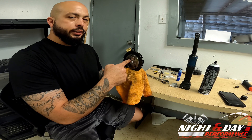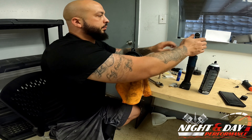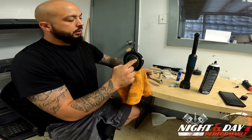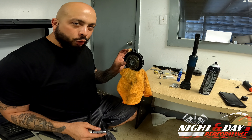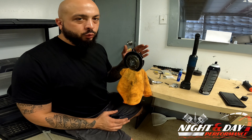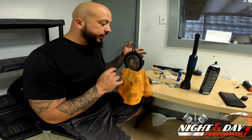This bolt right here is just kind of helping us keep everything in place — it is not required. Now I'm going to loosen this bolt just enough that this gear will move, about a quarter to a half of a turn. The only reason I put that bolt in is for the initial grab. There are three little pins holding this, and we want to make sure that the back portion, which controls our timing, doesn't come off or get damaged.